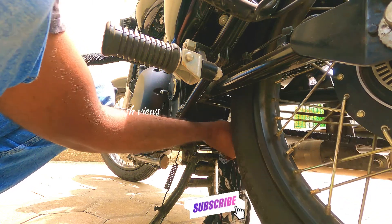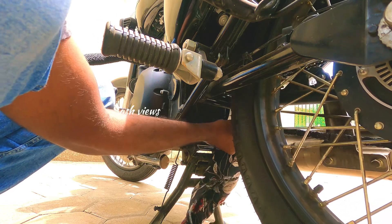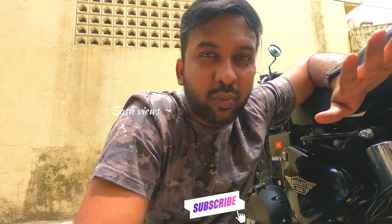How do you maintain the chain lube? Usually I suggest the chain lube every 500km. During the rainy season and long drives, I suggest every 300 to 400km. I have a bike service here — one month back you can get the chain lube done. In the rainy season, I go to the chain lube at maximum 300km.